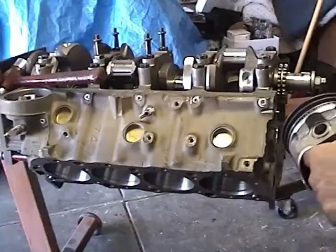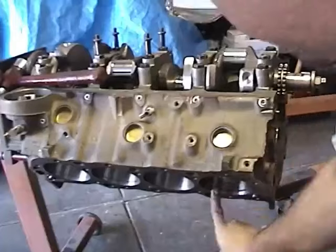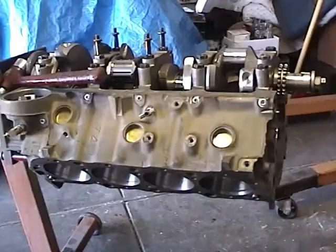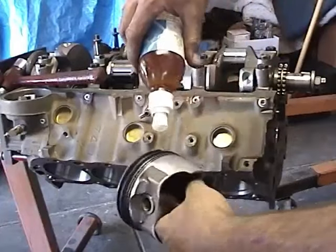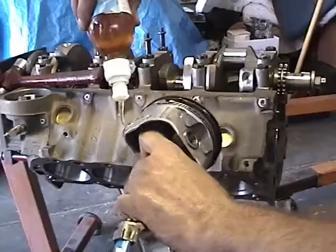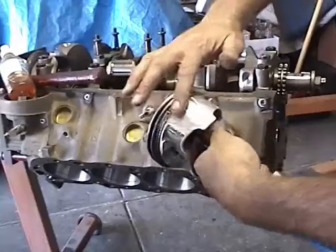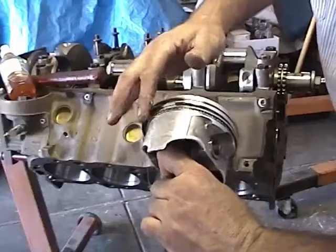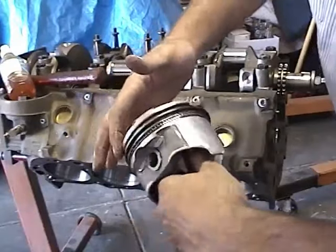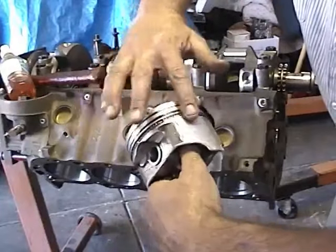So what we're going to do first is take our assembly lube and squirt a little bit in the cylinder wall — just go right around the whole thing and wet it. You don't have to goop it all up, just a little bit of work on there, a couple thousandths worth. I like to put some on the piston and work it in with my hand, just a light coating. Some people actually dunk these in oil, which I really don't recommend — it's a real big mess and it's not really necessary. As long as you get this piston wet, it's going to be fine. Just make sure you touch all the aluminum on here.